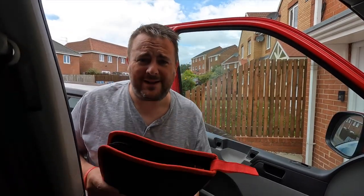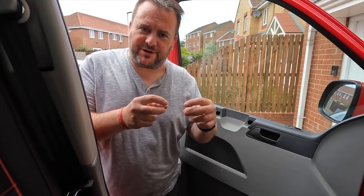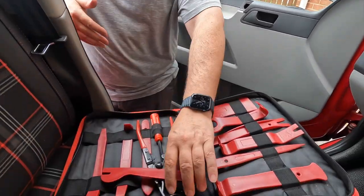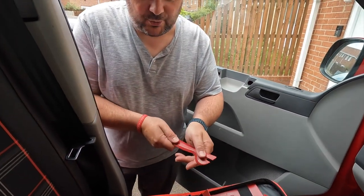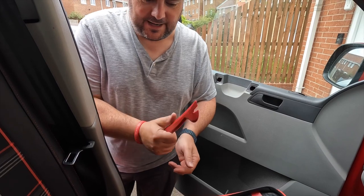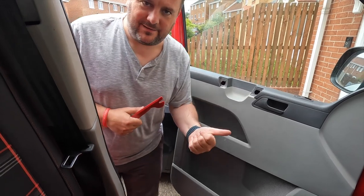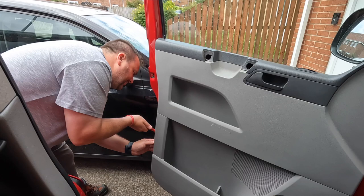Part two - we're back at it. It wasn't coming off. It looks like my door card's never been taken off before because it was just tight. There are some poppers on the back that need to sort of separate to allow it to come away from the door, but they're just not coming away. So I've gone and got my trusty trim kit tool - this was like a tenner off eBay or Amazon. I'm just looking for something that I can push between the fitting to lever the two parts of it apart.